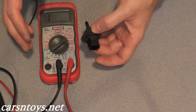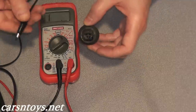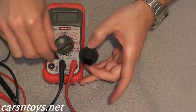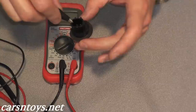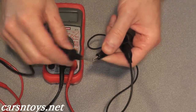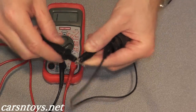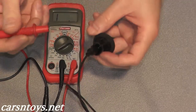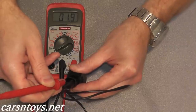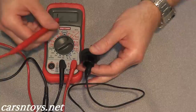Right now it's around 65 to 70 degrees Fahrenheit, which is approximately 20 degrees centigrade, and we should see a reading between 2 to 3 kilo-ohms. Select the kilo-ohms setting on the multimeter. I'm using an alligator clip clamped to one of the prongs inside the sensor — it's just easier than holding two leads at the same time. We're reading 1.8 to 1.9, so we're pretty much in range. As we heat up the water, this reading should drop.